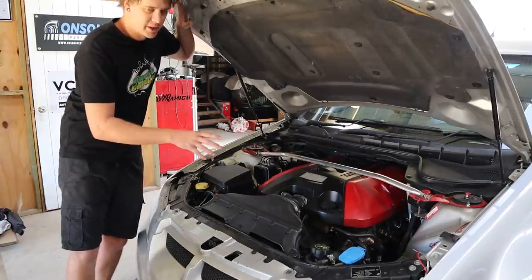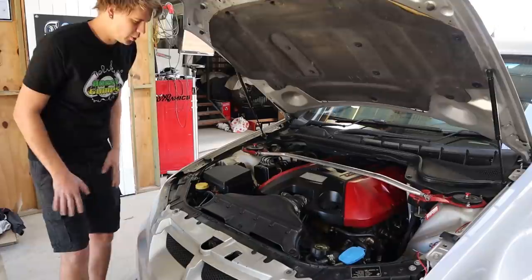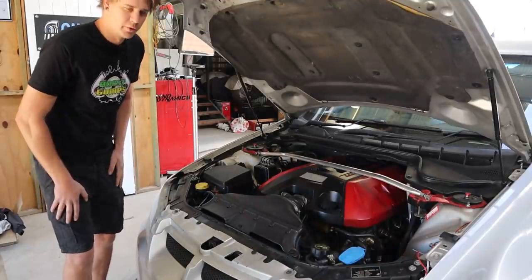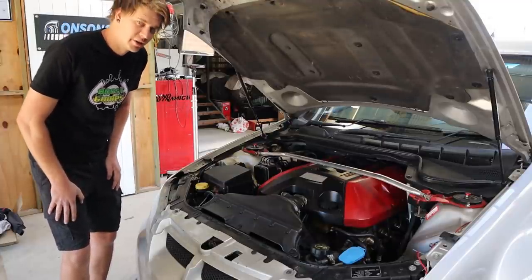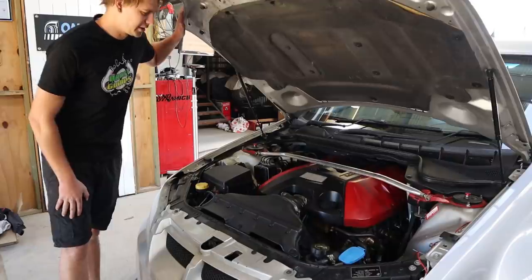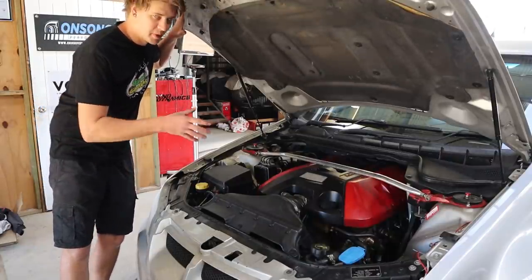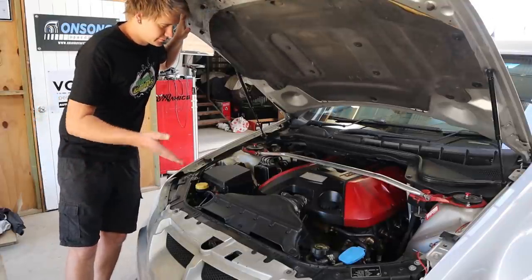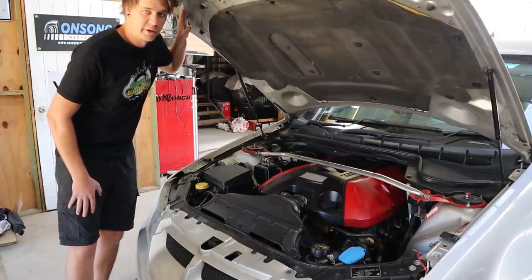So being that they're 243s, we don't want to just be swapping them for a set of ported 241s or something like that, because it's a HSV, we want to keep the 243s on this thing. Very, very important for just the vintage of the car, you know. They're a pretty special thing. It's not like we can just go swapping them over. So for that reason, we sort of need to send the 243s away and get them back, which means for a quick turnaround to get this job in and out, get it done so it's not another car that sits here for 6 months, we'll just use Higgins, I think.